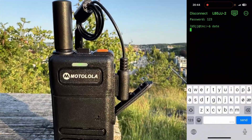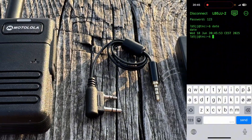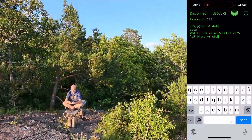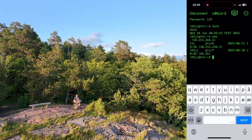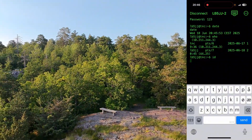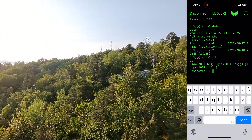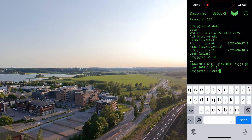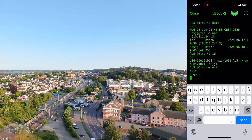This is not the fastest way of doing this — I could do it over mobile data, which would probably be about a thousand times faster. There we have the date. Let's have a look to see who's logged in — hopefully that's no one else but me. You can see I have one login over the network and one login over AX.25. We can check our login user ID. This is just to show that I can actually log in and get a login shell over AX.25. There's no control key here, so typing 'exit' is probably the tidiest way of disconnecting. And we should see up in the top corner it went from disconnect to close, so the AX.25 connection is closed.